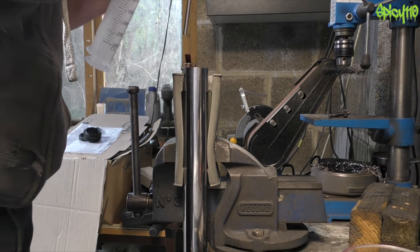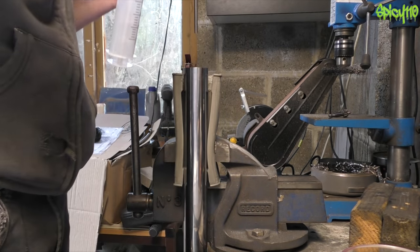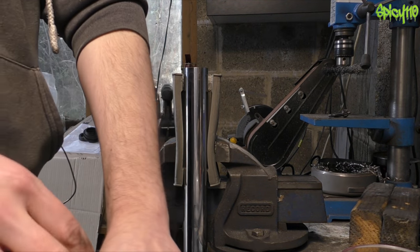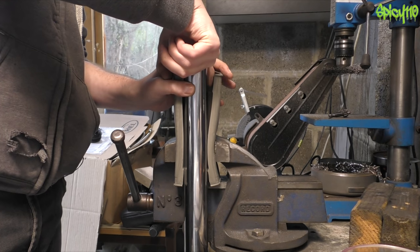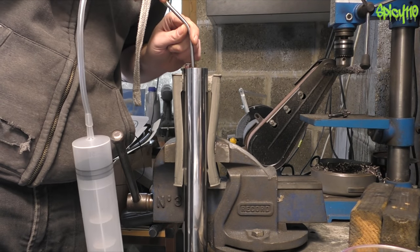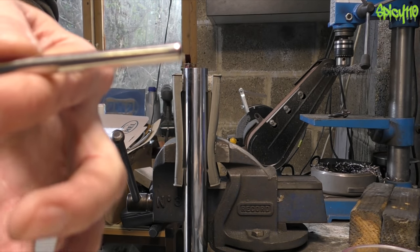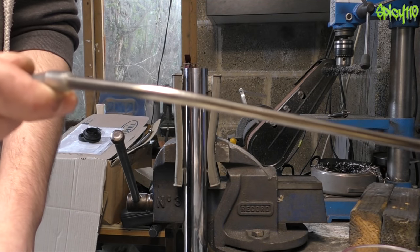I'm slightly concerned my tube isn't long enough to measure the level. I'll put the spring and the washer in and see if that brings the level up enough to reach it — an after-spring-installed measurement. By sheer dumb luck, when I go down to the mark on the tube it leaves a very slight oil ring just on the tip, which means it's exactly that length. The tool worked out great but the straw was just too short.